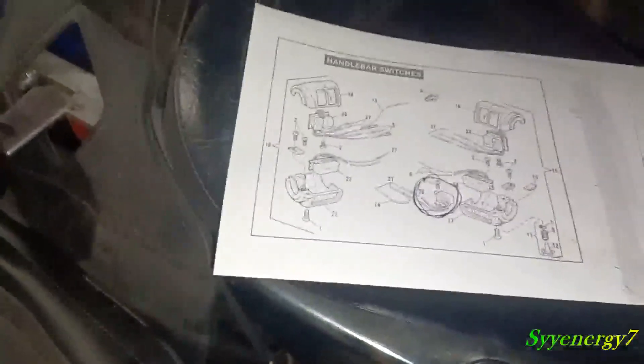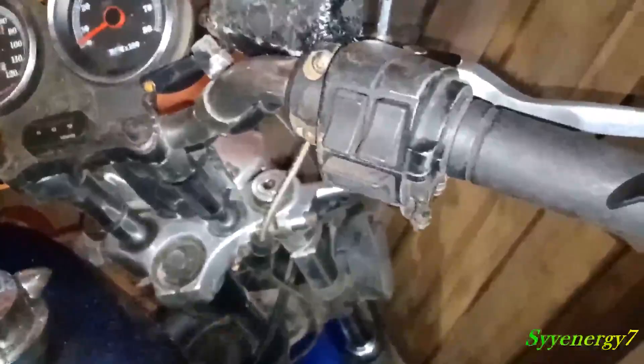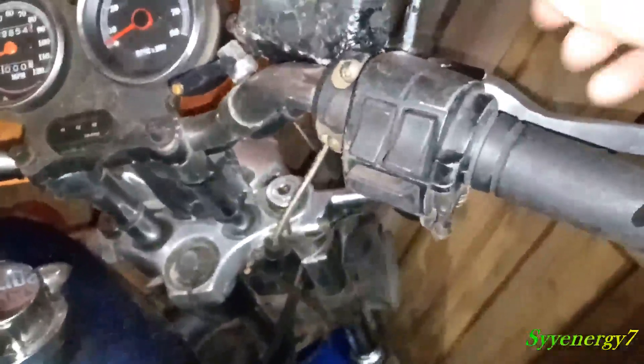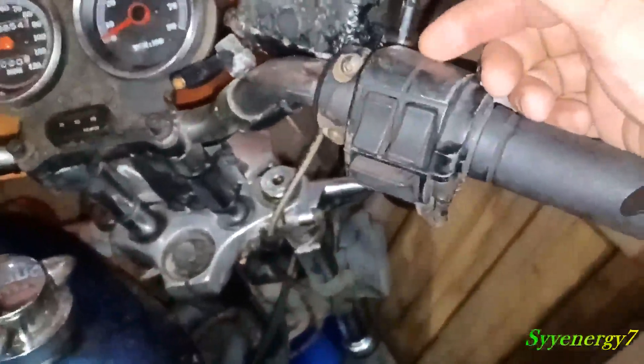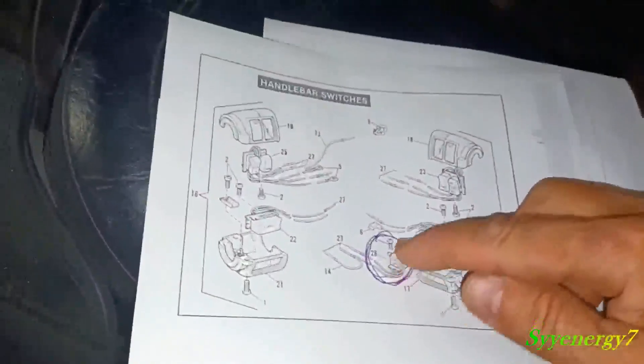I was messing around with this for about two hours yesterday and said there's got to be a way to make this work. A lot of times they're saying lubricate the switch — that could be it too, maybe the plunger's stuck or needs to be cleaned. But what really happened is the end of the plunger on the switch is plastic, so it's going to wear down a little bit. If you bend that lever just ever so slightly so it pushes that plunger, your brake lights are going to actuate the way they're supposed to.